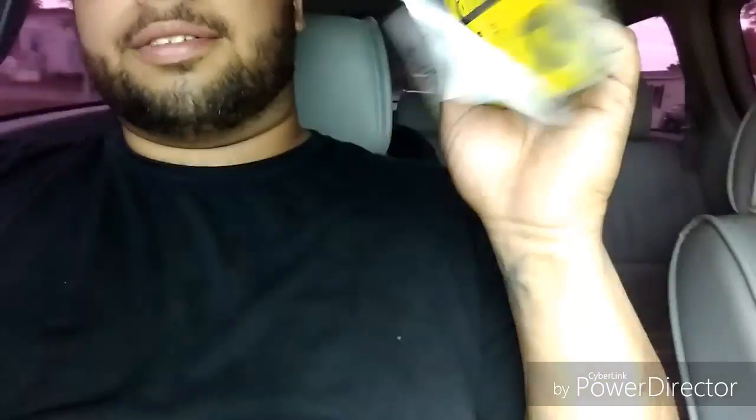The belt was the wrong belt, had to take it off — this is some haggard garage stuff. This is what the belt looks like right now, it's no good. The belt was shorter, shorter by an inch. So now we gotta go to the AutoZone. This is the alternator belt to the water pump — the one I put in was the wrong one. Time to get the right belt.